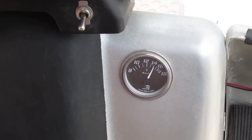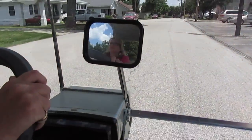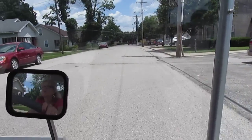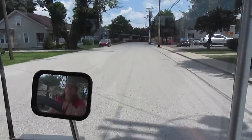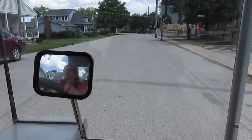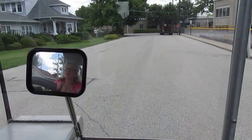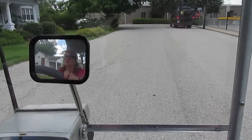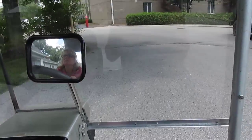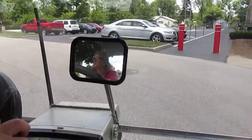You can see the battery starts charging. It really rides smooth. A two-cycle engine is a little rough at first but then smooths out nicely. With that exhaust muffler and tailpipe, it quietens down quite a bit. Now, we removed the governor off this, so you have to be careful how far you put the pedal down — nothing controls the speed. If you put the pedal all the way to the floor it'll over-speed and eventually blow the motor up. You can probably run about 15 miles an hour safely.